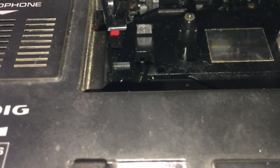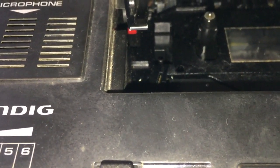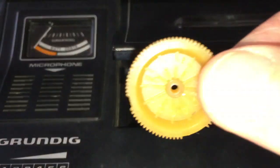The little cog on the right — you've got left and right — that's the take-up spool. That wasn't spinning because the Grundigs have problems: they've got a Phillips mechanism inside and these cogs wear out and break. I want to show you — that's the old one.